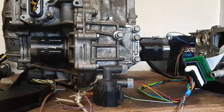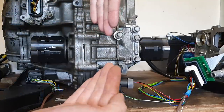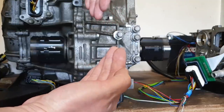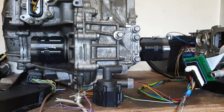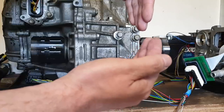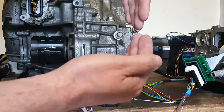That is another clear sign that we're homing in, because what's happening there is that as we're ramming the current into the stator, the magnets in our stator and the magnets in our rotor are very nearly perfectly aligned. This is what we're trying to do. We're trying to line these magnets up. That's what sync offset is. So right now they're very close and the rotor is just doing a little shimmy. It can't flick to turn, but it's just shimmying around that fixed magnet.